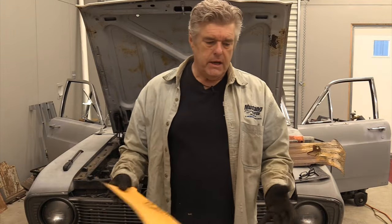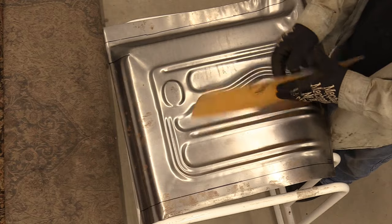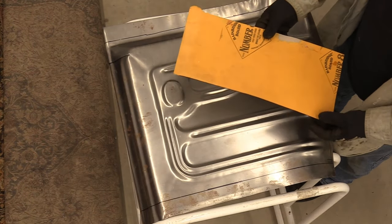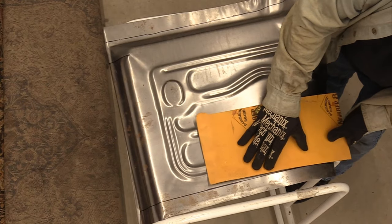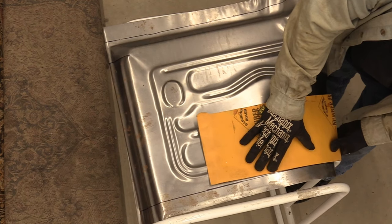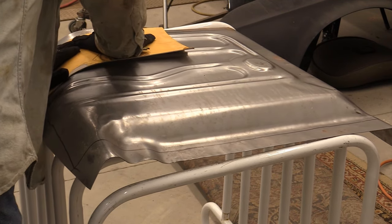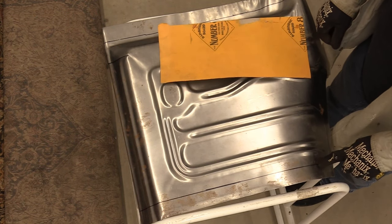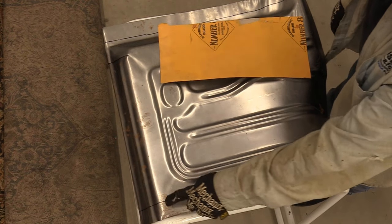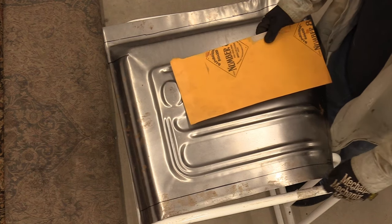Another little tip: if you're going to have to make straight lines on your panel, if you go down to your local hobby store you can get some stuff like this. This is a cold pressed illustration board. The illustration board is really nice for being able to keep a straight edge if you use the factory outside edge of it. You can cut it down, do whatever you need to do. The nice thing is this illustration board will lay pretty straight across the flat areas and it'll bend to go around the corners to give you a straight edge as well. You can take your marker and put little marks along here to where you want to be, measure from the outside edge to where you want to make your cut, pip it along there with the black marker, and then use the illustration board to keep a nice straight line. Because once you go around the curve, things are going to change just a little bit.